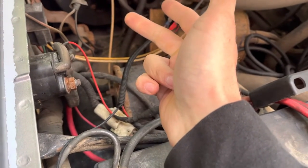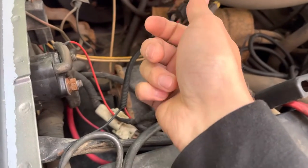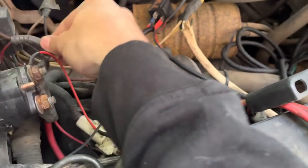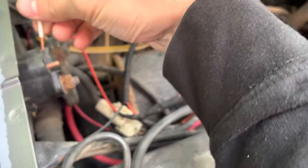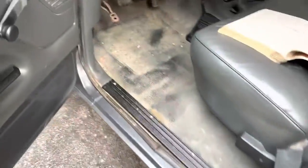And you have the clutch engaged, or the key is turned to the run position. So if I pop this off and just touch this with 12 volts, the truck starts up. So that tells me that it's either the ignition switch or the clutch neutral safety switch.